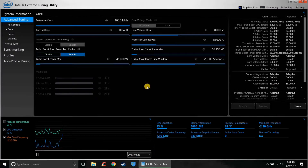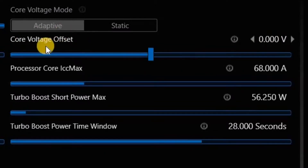Now all this stuff you just need to ignore. The only thing you need to look at is the core voltage offset — that is what we're looking for. Since I'm on a Dell Inspiron 7559, I've already tested that the best negative voltage I can go to is negative 120. If you're also using that same computer, it has a Core i5-6300HQ, so if you have that exact processor, set it to that. You can also tamper with going lower and higher as well.